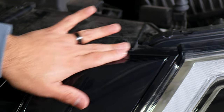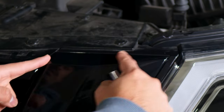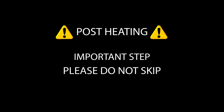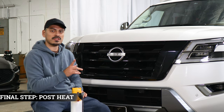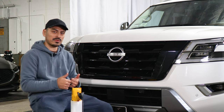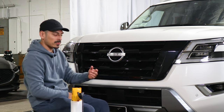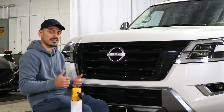And that's pretty much it. All of the steps that were done from this side, you would repeat on the other end. To finish it off, we would post-heat the entire pattern. Once we finish with the entire installation, the last thing to do is to apply heat — that way we help the adhesive on the film activate faster. Make sure you go section by section and post-heat the entire grille. Take your time when you're doing this, and then once you're done with this step, you're done with the installation.